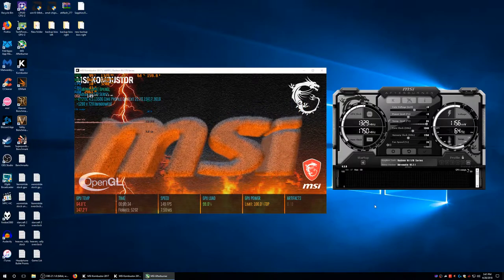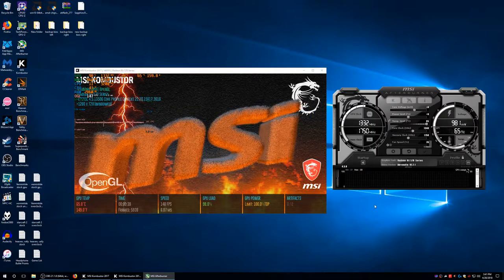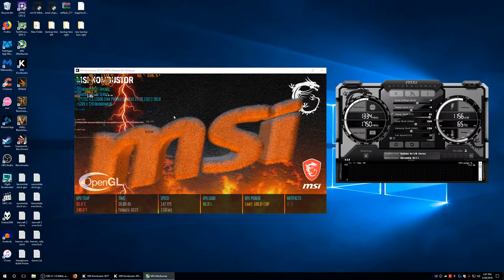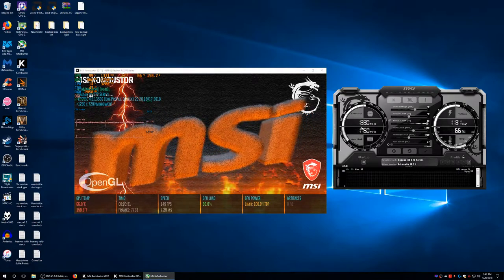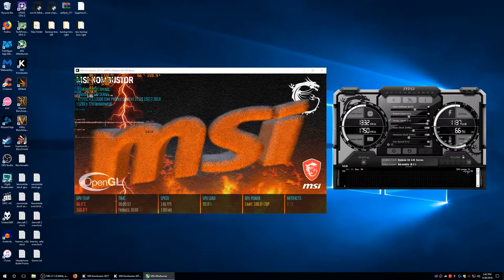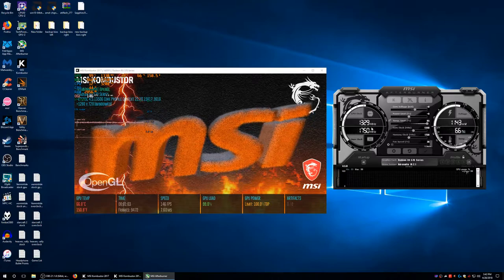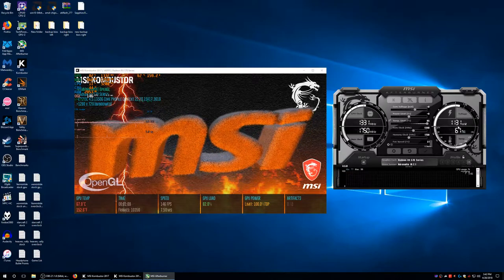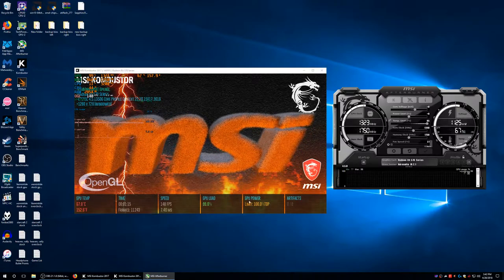If you have an NVIDIA graphics card, you don't really probably have to flash your NVIDIA driver because most people aren't mining on those — they're not modding the BIOS. That's usually done on AMD graphics cards. Now in this program it's not quite hitting 1340, but if I run Heaven it's going to hit 1340. You can see my GPU at stock is actually boosting to 1340 like it should, but my millivolts is going all the way up to about 1150.